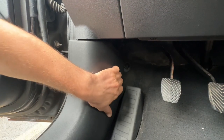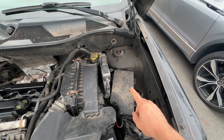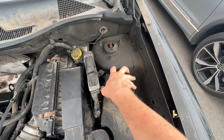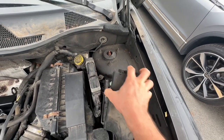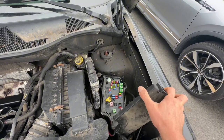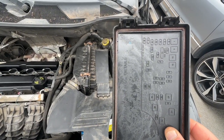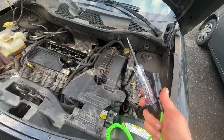We pop the lid and our fuse box is there. To open it, we just need to press these two tabs, pull it up and it should come off. In reference to the owner's manual on the electrical diagram, which I linked in the description, the fuse number 13 is for the power socket.